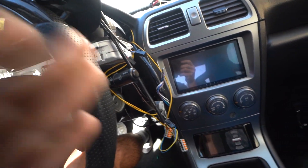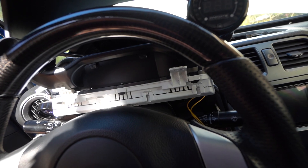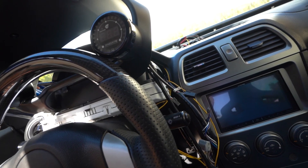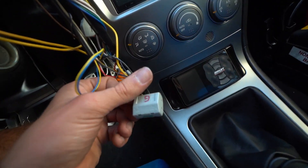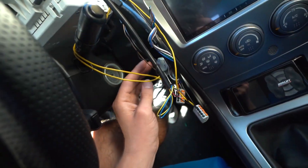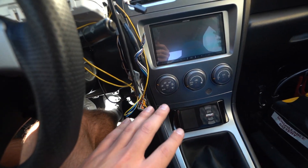After a whole bunch of absolute nonsense, this is way cleaner than it was before. By the way, they're called WAGO connectors — not Waco, that's a place in Texas. This is way more organized than you'd think. I got the ground labeled. Everything is coming from the clock up there: I've got ground, switch 12, and also the illumination wire. So when you turn on the headlights, the clock dims — and the gauges will dim as well. Got all of those hooked up.